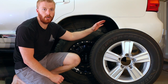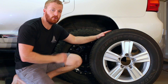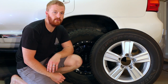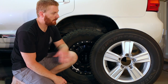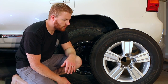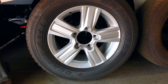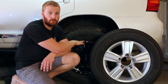We brought over the stock tire to compare. This is the stock Land Cruiser tire off our 2014 Land Cruiser 200 Series Sahara. The Sahara comes out stock with 18-inch alloys. When you compare the ratings, they come with Dunlop Grandtrek AT25s in a 285-60-18 size. These stock tires are only capable of holding about 1,250 kilos, which although is enough for our GVM upgrade, is just slightly less than the BF Goodrich at 1,450 kilos.